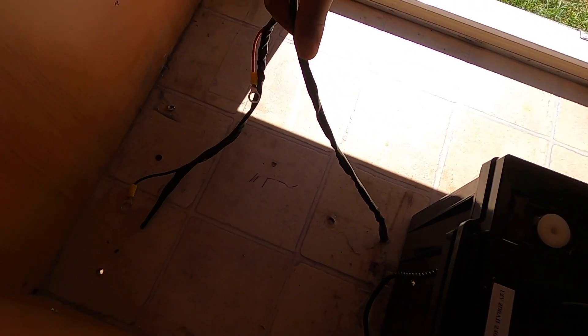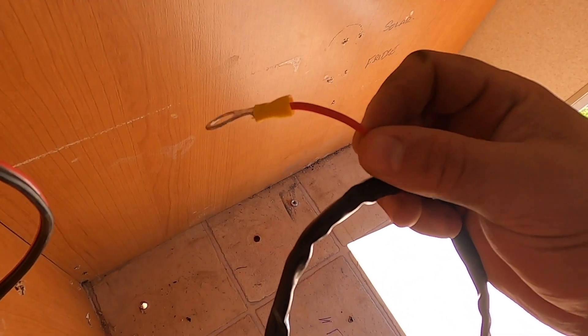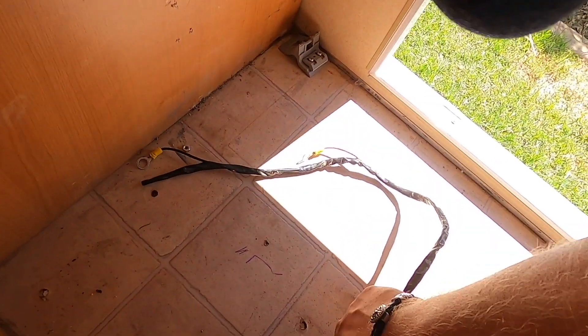This cable right here is the cable that comes up through the floor from the Anderson plug at the front of the trailer. I think this has just been added in. Originally it would have probably been off the seven-pin plug, but someone's just added an Anderson plug cable in. That's going to have to come out. I'm going to pull that back through the floor — it's really light duty. So if I'm going to be running 40 amps through this cable, I want it to be a bit thicker than that. I'm going to run a whole new cable for that.